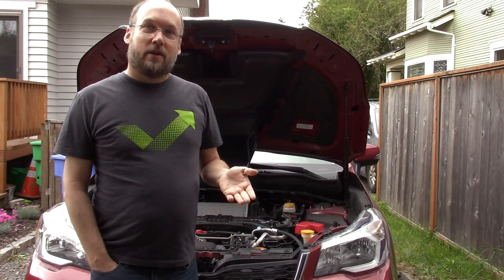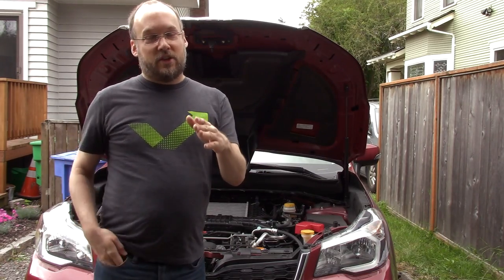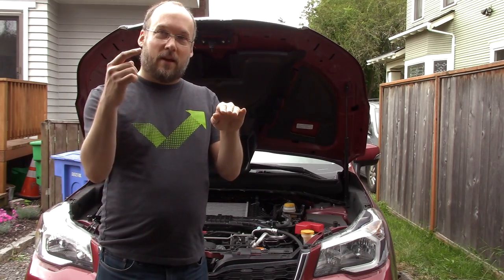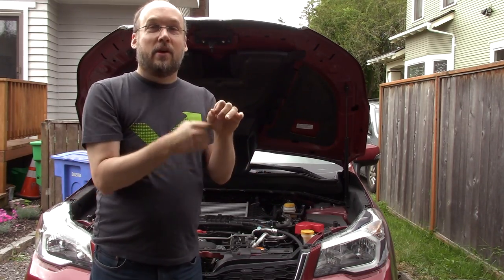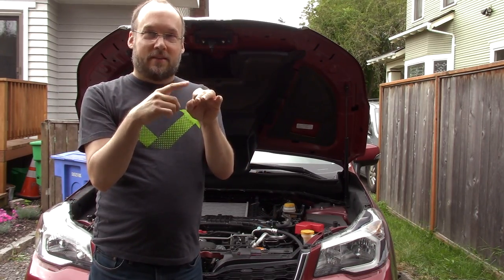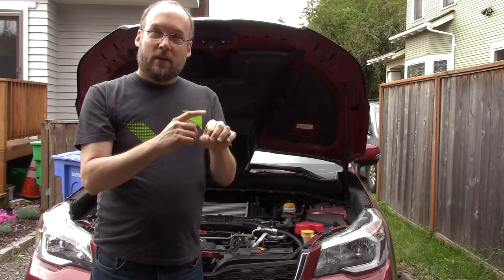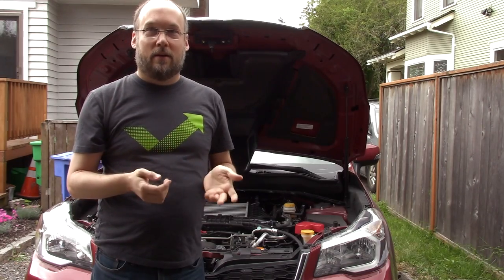on a normal fuel injected car, the fuel is injected into the intake manifold just before the intake valve, and as the valve opens, the air-fuel mixture passes into the cylinder, and the gasoline has a detergent which cleans off the tops of the valves, and that's over the lifetime of the car. You know, you get a little bit of carbon, but it's basically a non-issue.